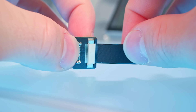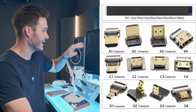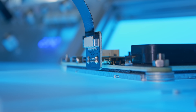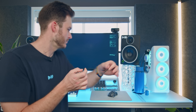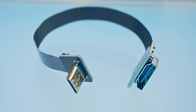I can plug this ribbon cable into a header on a circuit board with an HDMI plug. When I was shopping online, I could buy any male or female HDMI plug. The touchscreen requires a male mini HDMI tip. To free up space, this needs a right angled bend that has to bend up from the plug. The right angle either bends up, down, or even left to right from the standard HDMI orientation, so this has to be the thinnest tip I could get for the touchscreen end. For the PC end, I could get a really long ribbon cable and run it all the way through, but this ribbon is quite annoying to route because it only likes to bend one way. So instead, I could use a straight female HDMI tip, turning this into more of an adapter and extension cable.